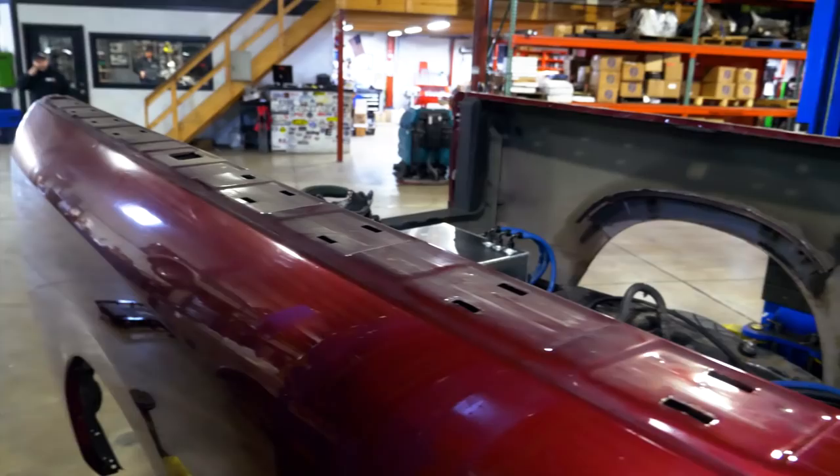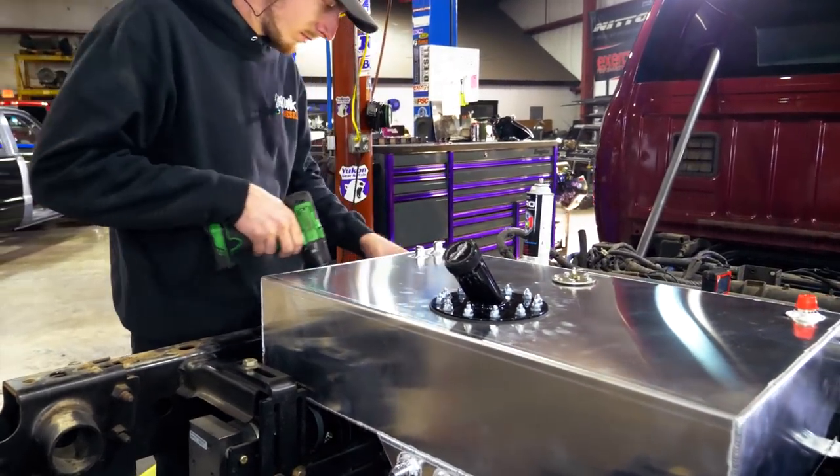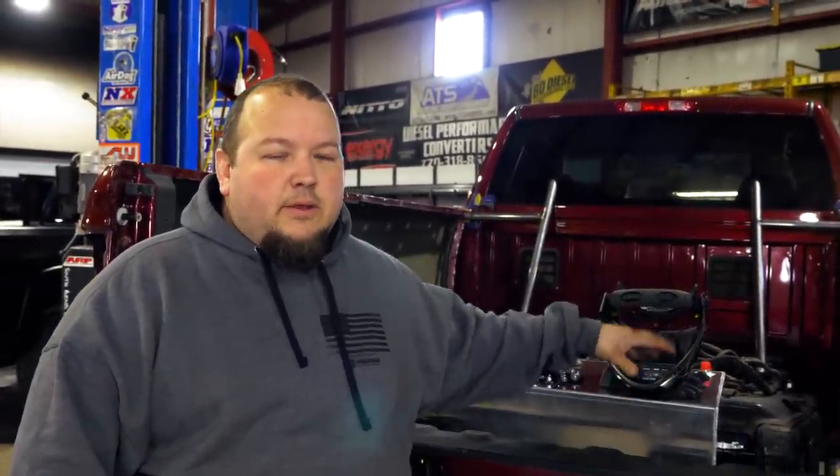This week we're working on finishing details on Dallas Penn's truck — probably here for another couple weeks while waiting on a few things. We've got the bed skin working on getting it mounted back up. In the back it was simple — factory mount locations — but in the front we have to build supports to hold the front of the bed. We've got the uppers pretty much done and are working on lowers. We also have an all-aluminum bed skin coming to finish things off. We need to put a set of coilover shocks on it, getting a set from Minsker, and waiting on those for a week or two. Also doing control arms on the factory four-link in the back.